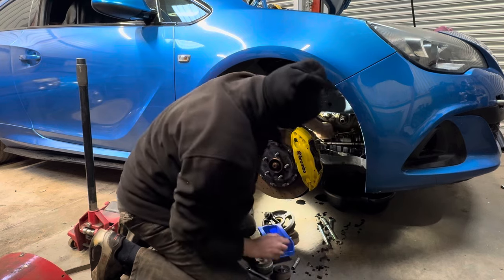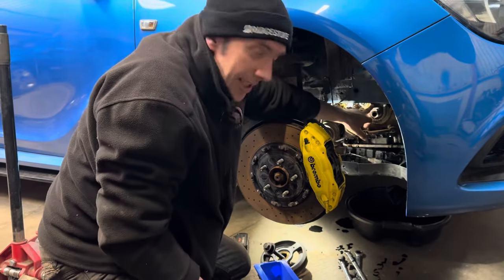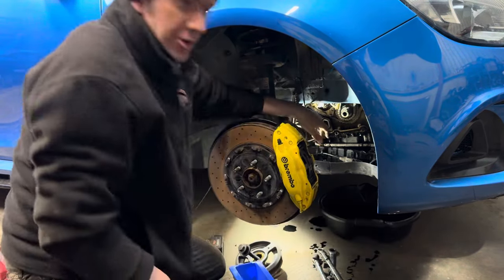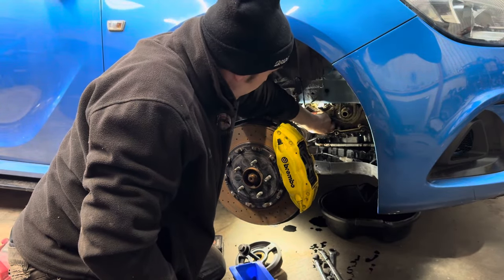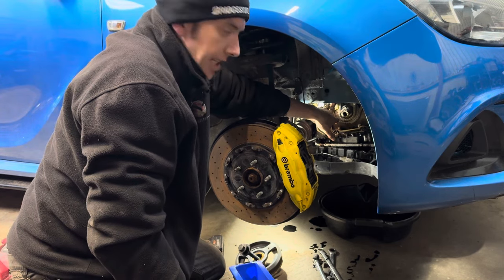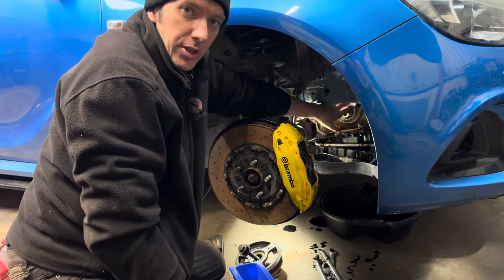Okay, so looking at it, all the guides are intact. None of the wheels have lost their teeth. So it looks like possibly the tensioner has been at fault for allowing the chain to drop a few teeth. But it can possibly be snapped guides as well. So whenever you take the side casings off, always look and try and establish what's the failure in the first place. What's the reason it's managed to go off time?